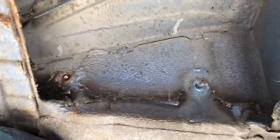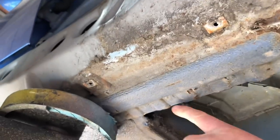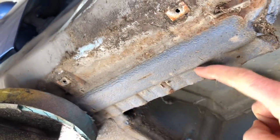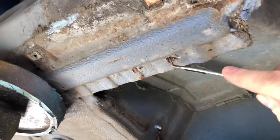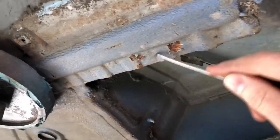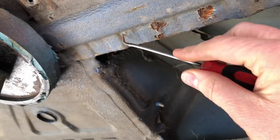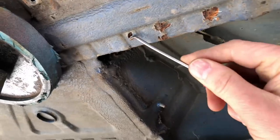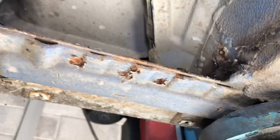Sometimes they come undone, sometimes they don't. So we've got that to do — we'll have to put two new rib studs on the chassis. Looking at the right-hand side, we've got that pickling of corrosion here, which I'm pretty sure will be quite an amount once we start taking the seam sealer off. There's a bit that's coming off there — quite open to get a pick so I can show you on camera what's going to be under there. Not much of that is going to give the car much worry because it's not structural, but nevertheless it's not nice to see that rust is actually starting to form. What looks like a raised spot there where the seam sealer wasn't broke at all is now corrosion, and that's because it's travelling from the seam section up here.